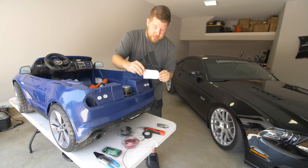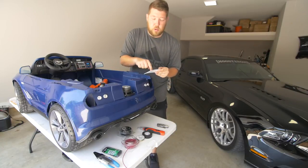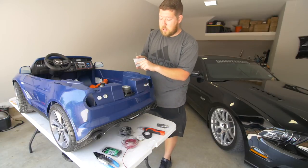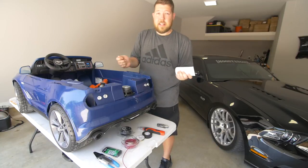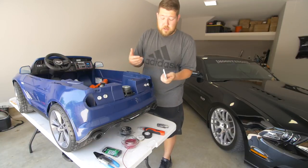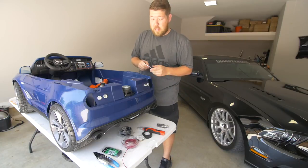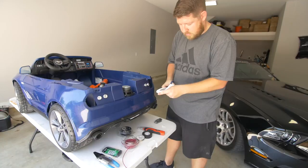So now that we have our piece, which looks about right to me, we'll go ahead and cut holes for the existing tail lights to fit into place. And what I probably have to do is draw a slit in there so that we can bend it in half and slide it around, because the wires are all the way through already and I don't want to have to undo those in order to get this in. So when you're doing it for the first time, if you go ahead and buy this, that way you can just run the wires through and you don't have to make the little slit like I'm gonna make.